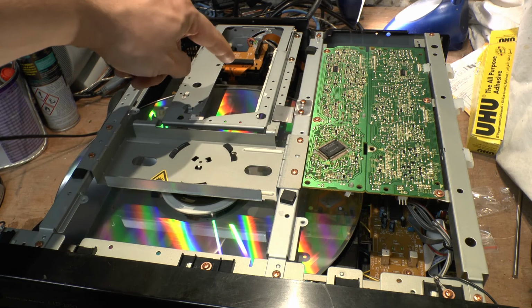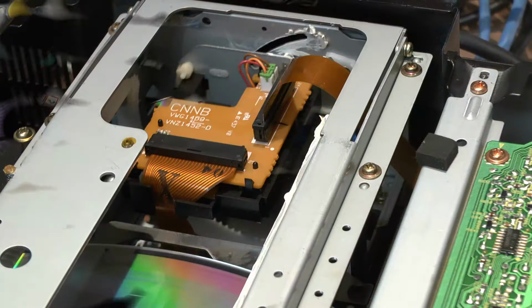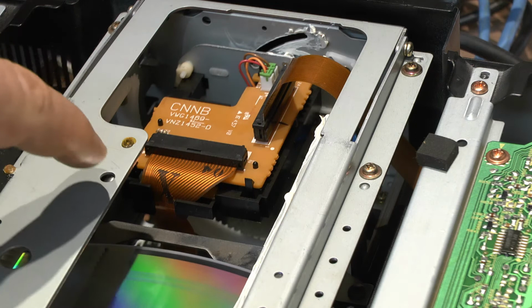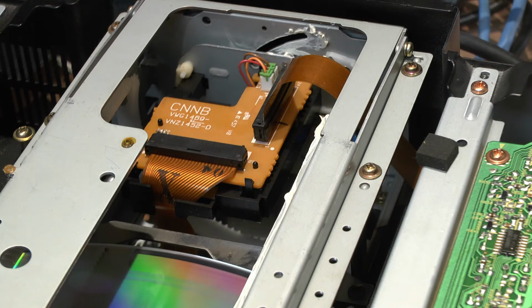Now, I'm going to zoom into this bit up here. I'm going to pause the video, zoom in, and let's see how it goes. Okay, you join me here, and now we're going to basically get the machine to flip the disc to side B. Now, as you will notice, the machine doesn't actually flip anything. What it does in this machine is it sends the laser up to this particular mechanism and rotates this full mechanism. That's the plan. I've greased it up because I suspect that's the reason why it wasn't doing it in the first place. I didn't try it beforehand, we're trying it now live, so first time ever flipping the disc. Will it do it? Here we go.